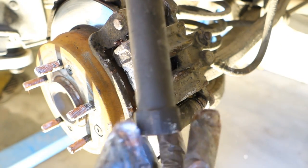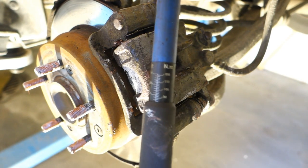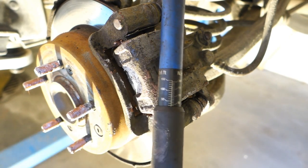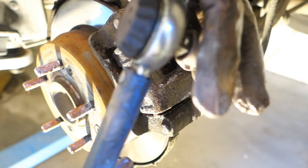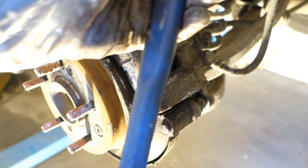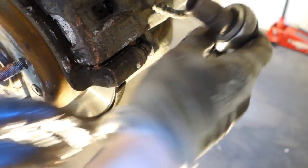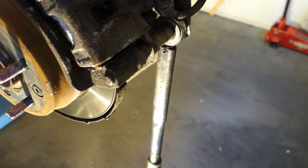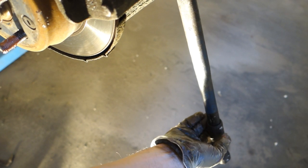This setting happens so that I rotate this adjusting bolt, and then this line becomes 30. 30 newton meters is in pound-feet something like 20. And then I connect my socket on that side. This torque wrench tool works so that when I move it and the tool clicks, it means that now we have enough force. First I insert the tool in here, and then when I start to move it and the tool says click, the force is okay.